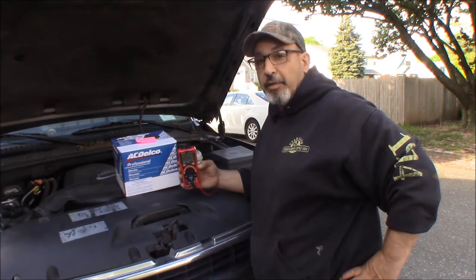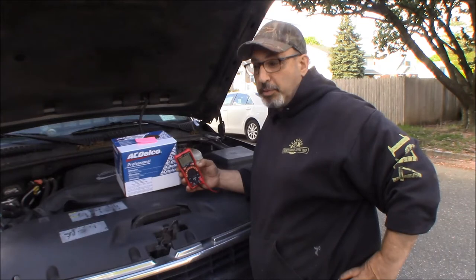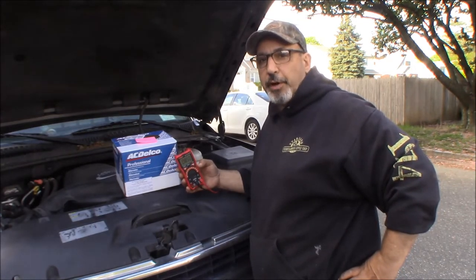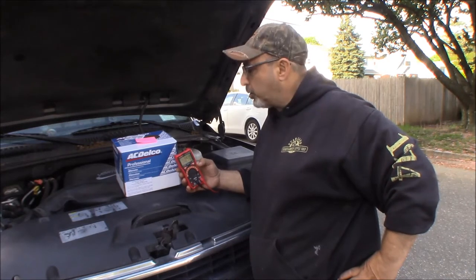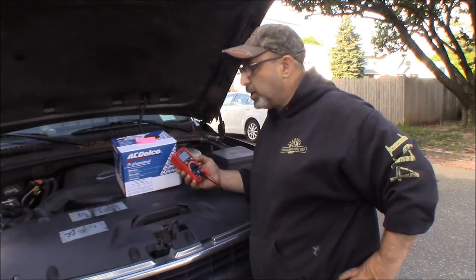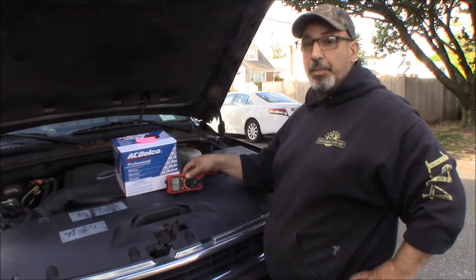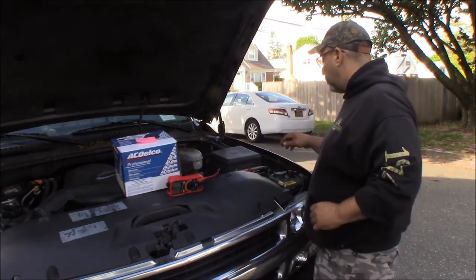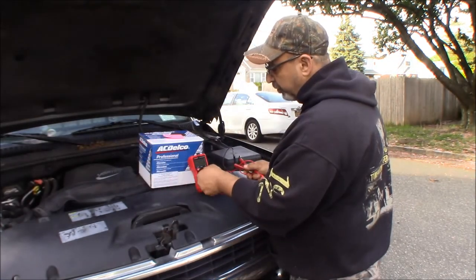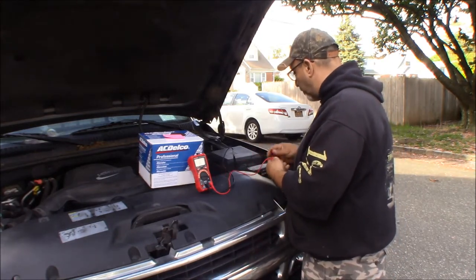We might have done this battery in with the alternator going and the battery going so low and us having to jump it a couple times to get it parked over here where we could work on it. I was hoping having the charger on it for 26 hours or so would have brought it back up to where it should be. So there's a good chance we're putting a battery in this truck too. Let's go with the alternator for now though. I'm going to put that charger back on and let's see if the charger is actually doing something. We know the charger is working, battery ain't taking a charge, that really sucks. So it looks like we're going to be putting a battery in this.